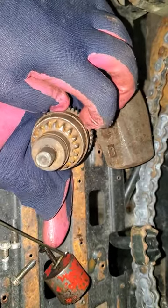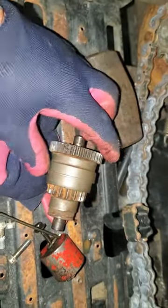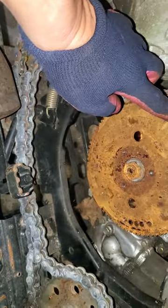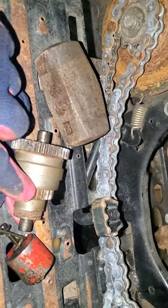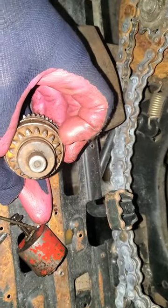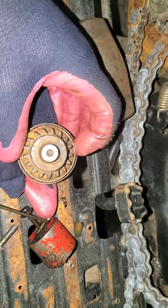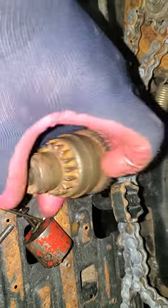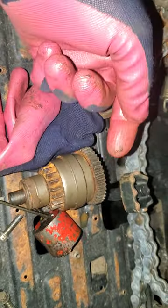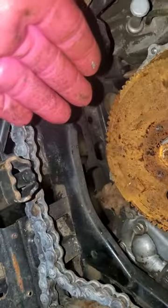So right now, unless I can soak it and get it to work, it's defective. It's not the starter itself but this intermediate starter gear thing between the starter and the flywheel. All I can do is soak it, maybe take some of the edges off from around there to get it to work, and re-spool the pull start to get that working and then put it back on.